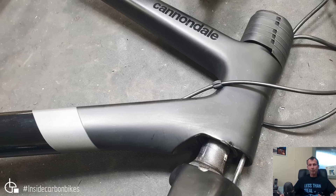For those unfamiliar with the problem, have a look at the other video — it goes into much more detail. But basically, when the fork rotates, you have a metal pin on the fork which impacts the side of the frame in this region here and causes delamination. The reason they limit the steering is because of the internal hydraulic cables. If you over-rotate the fork, it could potentially cut through the hydraulic hose, effectively acting like a guillotine on the hose, so then you lose the braking. I can understand why they want to limit the rotation.